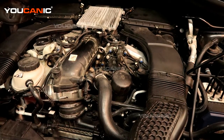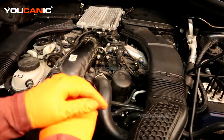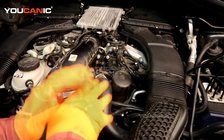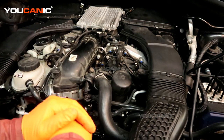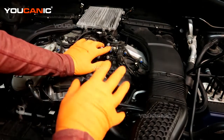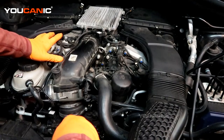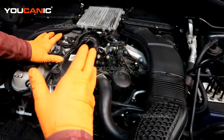A couple of reasons for an electrical fault: maybe you were replacing some other components and forgot to hook it back up, or something has broken down in the sensor. Bank 2 is on the right-hand side of the engine and bank 1 is on the left-hand side as you're looking at it from the front.